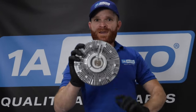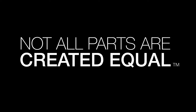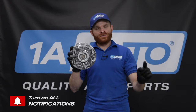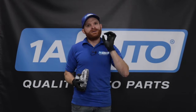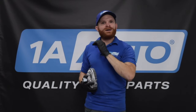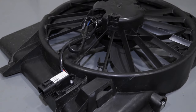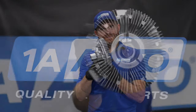In this video, I'm going to talk to you about cooling fan clutches. Hey friends, it's Len here from 1A Auto. First of all, I wanted to let you know that not all vehicles are going to have a fan clutch that looks like this. Some vehicles are going to have a fan that's actually mounted directly to the water pump. That's going to be on much older vehicles, or on some newer vehicles, especially engines that are transverse or that go side to side, they're going to have an electronic fan, which we can talk about a little bit later. This video is going to be specifically about fan clutches.